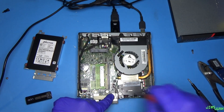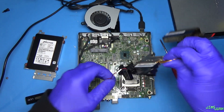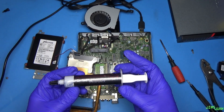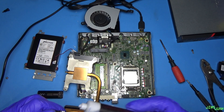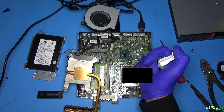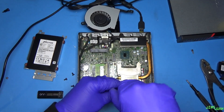And in case you're wondering, yes, I did go and replace the thermal paste while I had it all apart. The stuff that was in it was probably what it came with originally, because it was a bit dry. Some may be asking what I'm using for paste — this is Protronics Series 9. I'm not saying it's the greatest, because it's not. But it serves its purpose and it's cheap. I've had pretty good luck with it. I actually think their Series 7 performed a bit better, but regardless it works and I haven't had any issues.